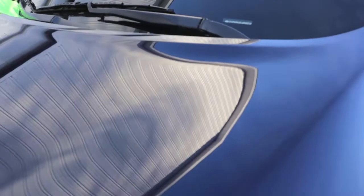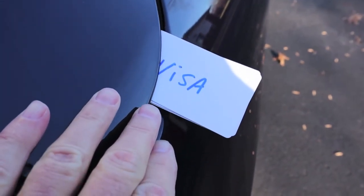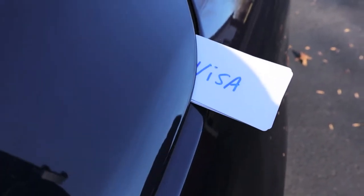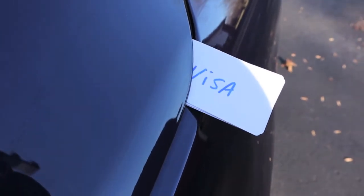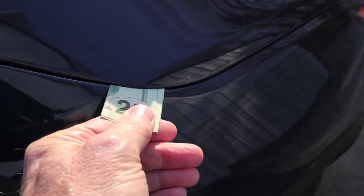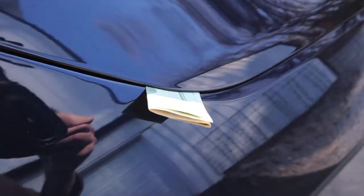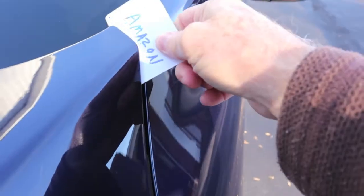Compared to ten thousandths of an inch, an eighth of an inch — let's call this right about a hundred, and this comes up to be about a hundred and eighteen or nineteen thousandths of an inch versus our ten thousandths of an inch. So we're pushing just a tenth of an inch difference — not too big of a deal. I'm not metal to metal here, even though I'm close. If I was metal to metal I'd have them fix it, but I don't want any hands on this car that I don't have to have on it. If I don't have any powertrain issues, I'll do my own service on it.